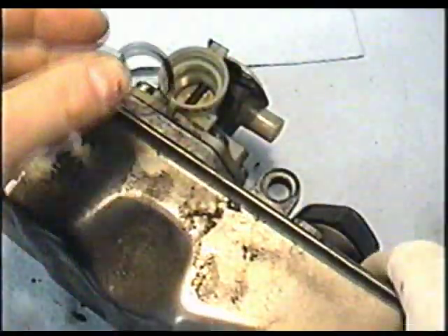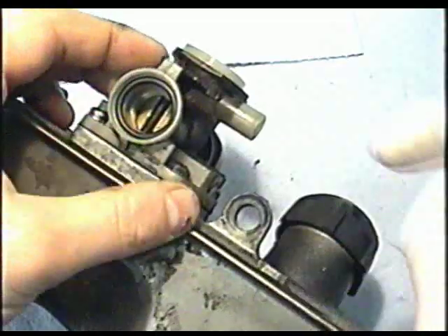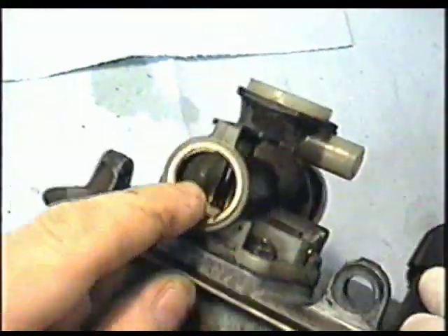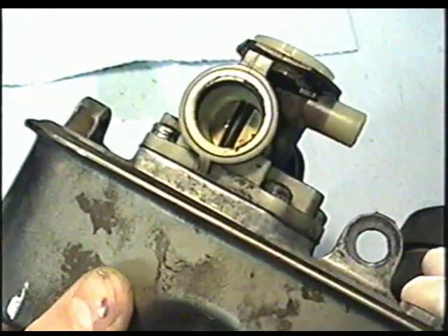This little insert and the o-ring go inside here. If they've come off your carburetor, just put them back in and clamp it in like that. When I took the carb off, these came off and stayed on the manifold part of the engine.